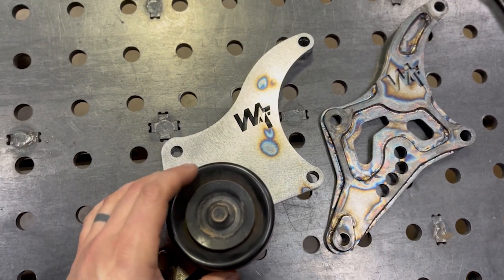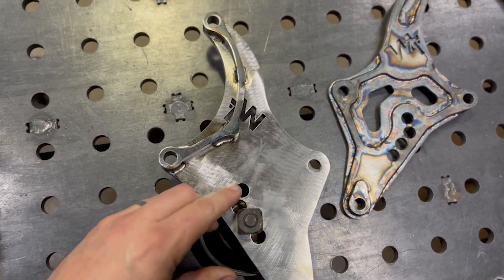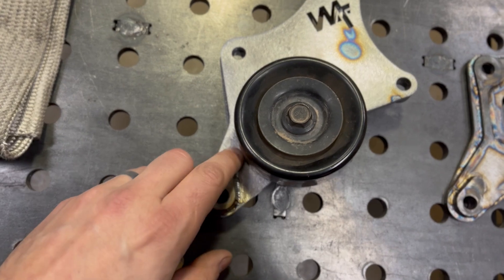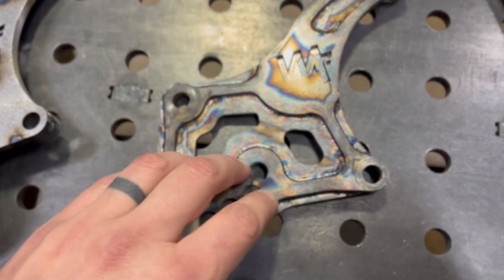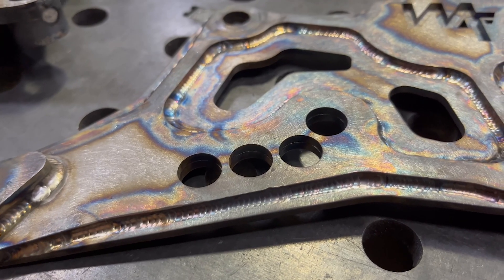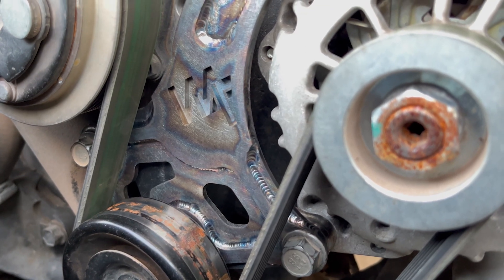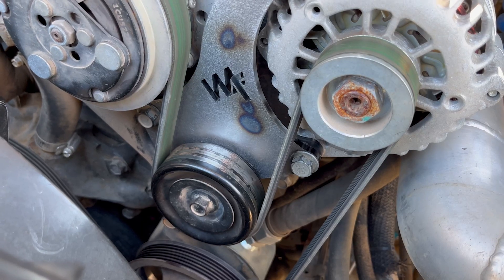Here are the two versions I've settled on. You've got Rev 1A, which is a very simple evolution of what I've been building. It's got a nice brace on the back — really good and rigid — and it'll have three positions for multiple idlers. The base plate of Rev 1A and Rev 2 are the same. I'm removing one idler position that nobody really used, and it put the pulley dangerously close to a bolt head — I don't want anyone shredding their belt. Rev 2 is a little bit lighter, and if you want something that's a personal expression of how I like to build with a lot of nice weld inches on it, it'll have a small premium. If you just want basic dual alternators and charging, Rev 1A is for you.